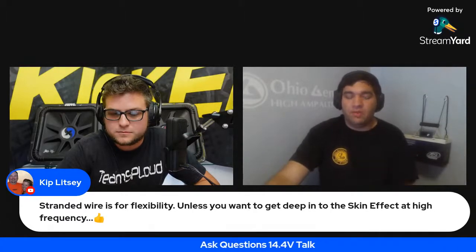He really does. The same thing happens with alternators. If you throw too small of a pulley on an alternator, it'll throw off the frequency in the rotor, shut down the regulator, and it won't charge. Really? Wow. Yep, that makes sense, but that's crazy. When Tom told me, I was like, wow, that's incredible. He's like, yeah, I tested it, and surely enough, it really does. If you put a real small pulley on an alternator, it will shut the regulator down.